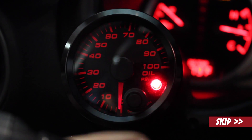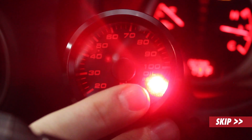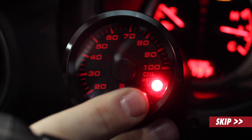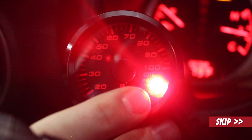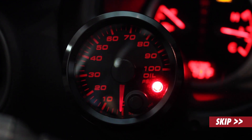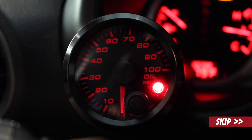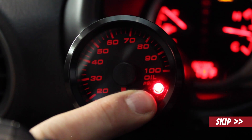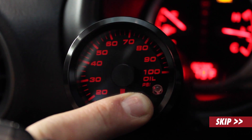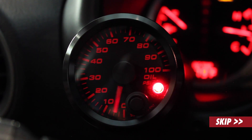All you're going to do is press the button once — it'll flash indicating that you're ready to change it. Then press the button to toggle through the brightness settings. For filming purposes, we're going to leave it at the lowest brightness setting. I'm going to show you the peak recall feature — press and hold the button until it goes to its peak, and it will show you both its high and low peak. The low was zero and the high was 90.